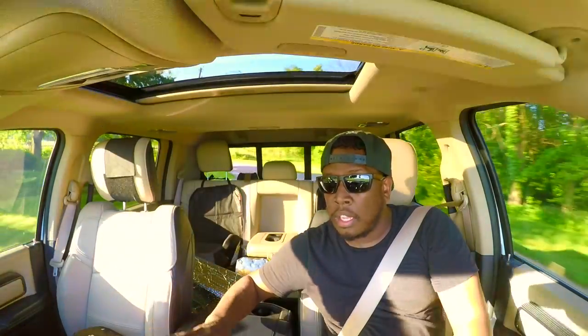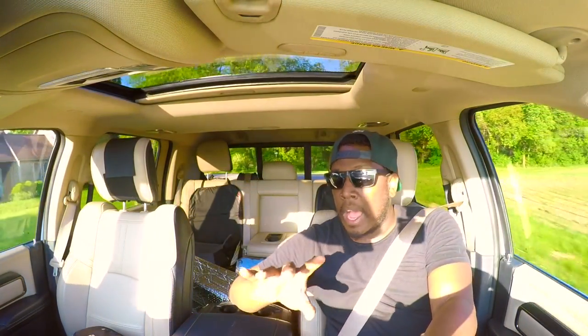I do like the way 12.5 looks, but in my opinion if you're going to go 12.5 tire you might as well go with an aftermarket wheel. Obviously you can use wheel spacers, but I prefer to keep this truck more in its stock form. My next truck I do want to do aftermarket wheels, maybe a two-inch lift — things like that. But this is my first time actually leveling the truck. I've always been against the blocks — or pucks, whatever you want to call them — so I went with the least amount of height increase. This is perfect if you're going to level a truck the cheapest way without upgrading shocks; this is 100% the way to go.